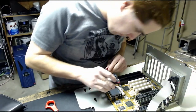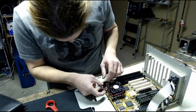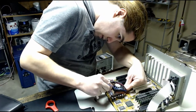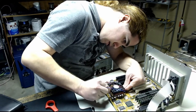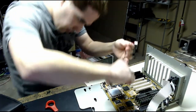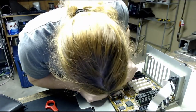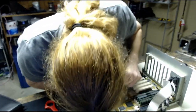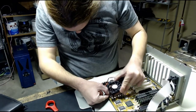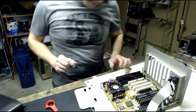This looks to be the CPU fan header. That's good. Alright, let's clip it onto the sockets. These different sizes on either side or something weird. Come on. Why won't you go on there? There we go. Just had to be silly or something. And then push this down, clip it on. Perfect.